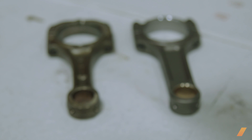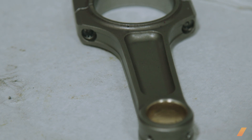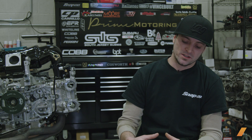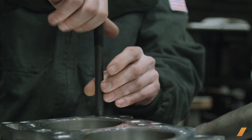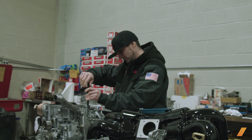There are different piston materials and alloys. You basically have two types of forged pistons: 2618 alloy and 4032 alloy. The 2618 alloy will take abuse a bit better but it does have a bit more expansion. Whereas with a 4032 piston, it isn't as resilient to abuse; however, it doesn't have the same expansion as a 2618. So you can run tighter piston-to-wall clearances, which may be more ideal for somebody looking for a forged piston but still driving the car every day and not trying to make 800 to 1,000 horsepower.